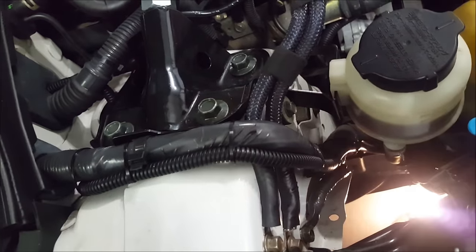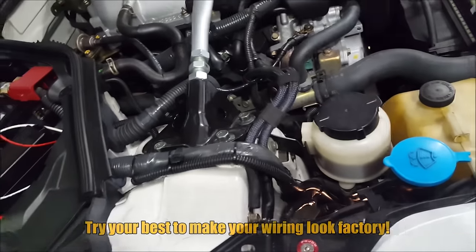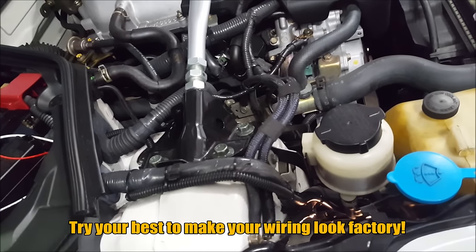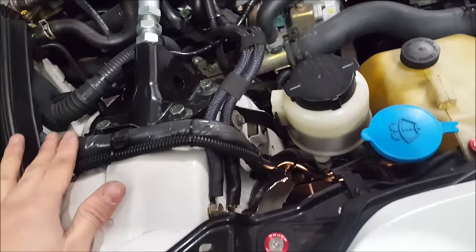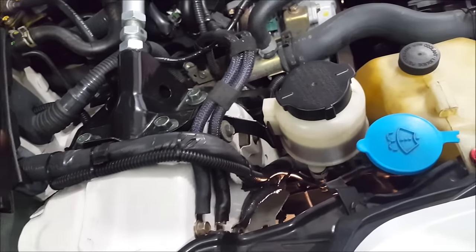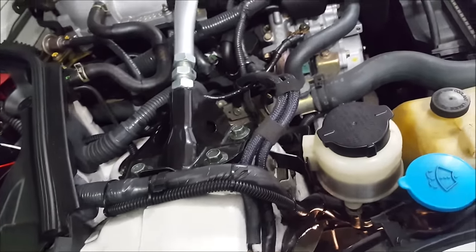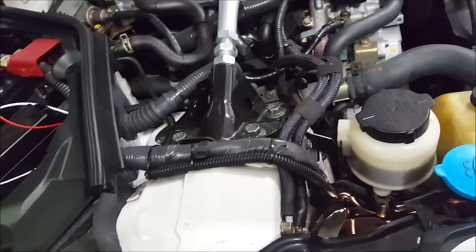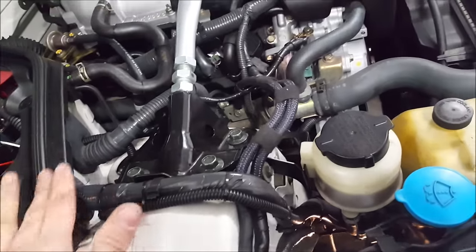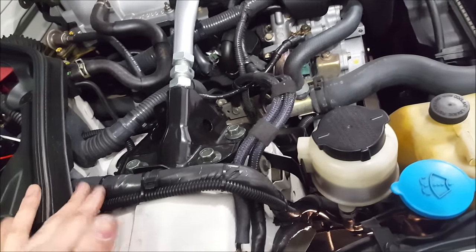It's going to be very hard for someone to detect that I've added more wiring to the car. I never want to see a rat's nest underneath the bonnet — it just looks so ugly. Take your time, find all the factory wiring, and run with it. It's not that hard to do, you just have to think that way, because a lot of people get really overwhelmed and confused when they have to add wiring. When I looked at this kit it was a little hard to deal with because I didn't know what was what, so I had to test everything — there are no good instructions with it. When it comes to running the wires, no one ever gives instructions, so you have to copy what the factory did. Don't reinvent the wheel.